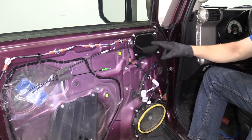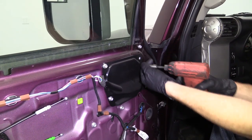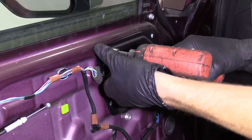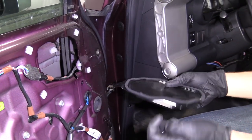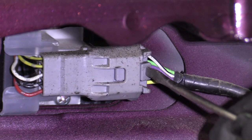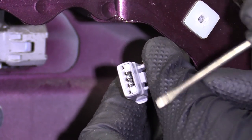Now we'll continue by removing these four bolts to get behind this panel. That's what it looks like — we've got our little seal here. Right here there's a little push connector; all you're going to do is push that and then we can pull off the wiring. I'll go right in between the tab and the connector and give it a little twist. Take a look at our connection — looks good, no funny colors, no rust or corrosion.